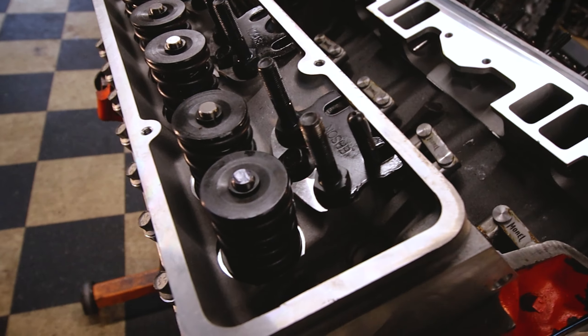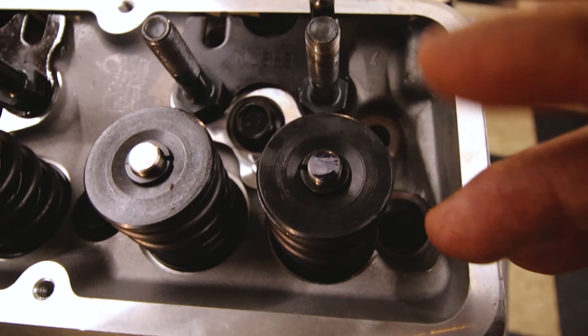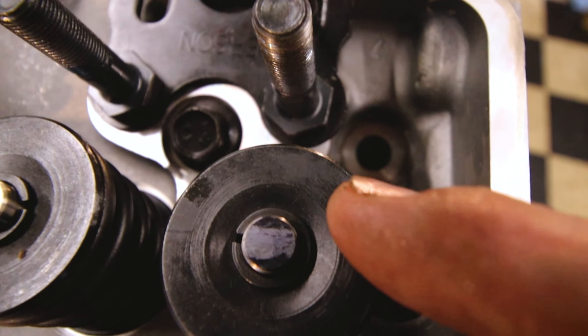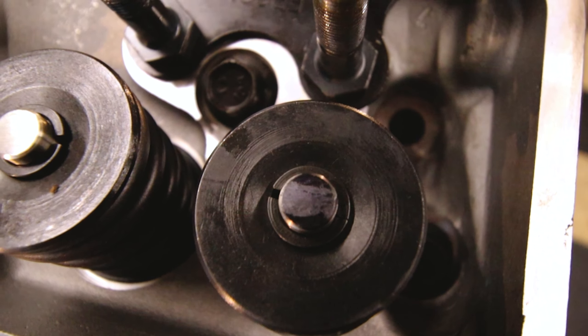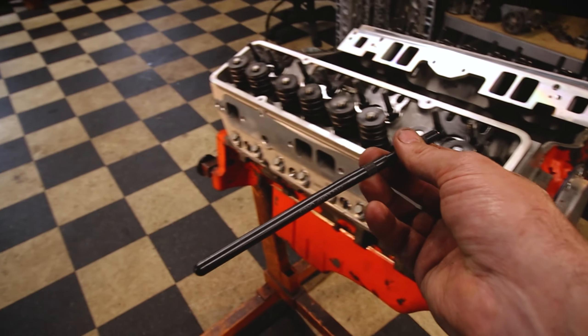I'm not going into crazy detail about this because I've done it before, but I do want to show you the wear pattern, because we're checking the pushrod length and we've got this set up so it's wearing dead in center — we've got the same amount on top and bottom. It's in the center of the valve, so we're going to go with this length right here, and we'll measure this, get it ordered, and then get this put together.